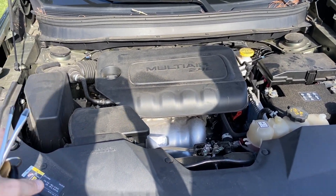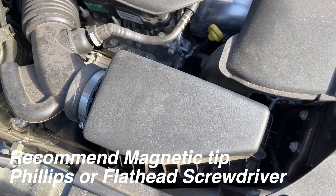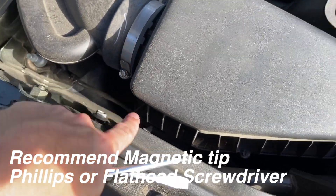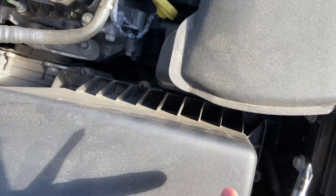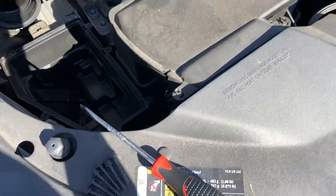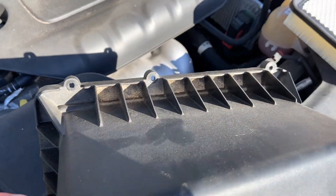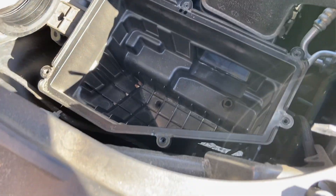This is the 2.4 liter engine, and your air filter is going to be to the right here. You'll be able to see the housing right here. On this housing you do have a couple of screws you will need to remove. You'll need to loosen the connection here — there's a screw right here, another one behind, one right here at the top on the side, and two more there. There are a total of six screws that you'll need to take out: one at the very top, two on the right-hand side, one kind of in the back, and three on this side. You also have to loosen this one here.